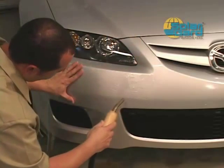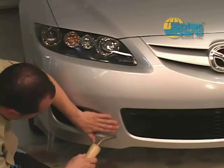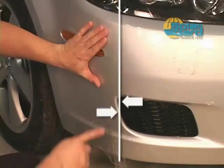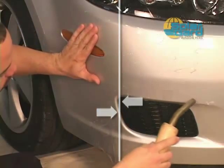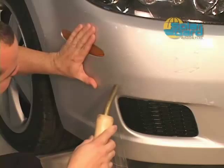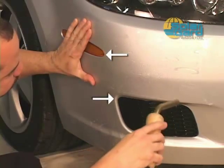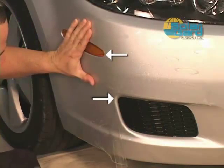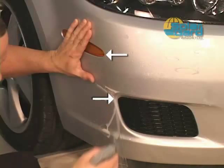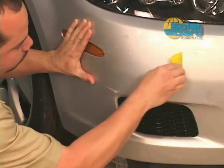Continue to one end of the car, following each body line and pacing yourself by the next turn in the bumper. The corner of the bumper can be the most difficult. It's where most of the tension is. As the installer wraps the corner, he must look at two focus points, one being the turn at the fog light, the other being the side marker light. In instances like this, you can steam the area and focus on these two points alone. Tackle one at a time.